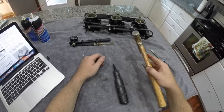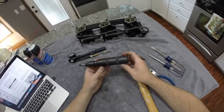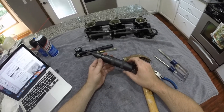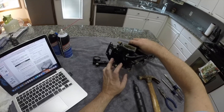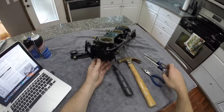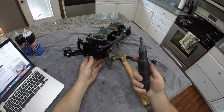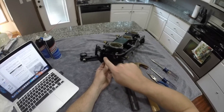You'll also need nose pliers, a hammer, and this — probably a lot of people aren't familiar with this one. It's called an impact screwdriver, and this thing is a lifesaver to make sure I do not strip out the screws on the side of the carburetor. If you've ever taken apart carburetors and tried to loosen these screws by hand, you've probably stripped them. With one of these impact screwdrivers, I guarantee you'll probably never strip one of those screws again.